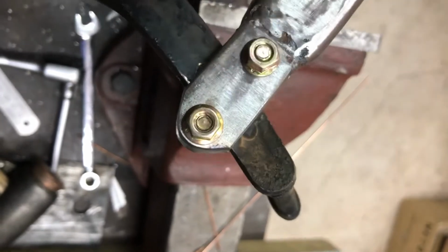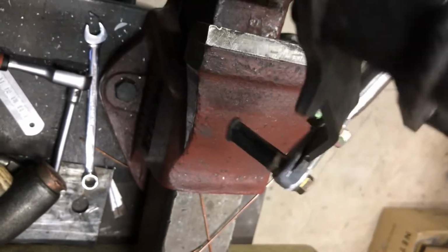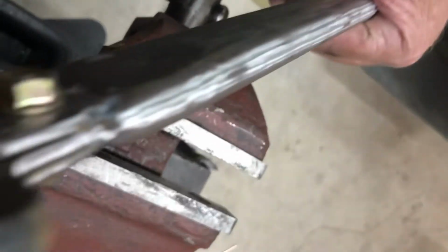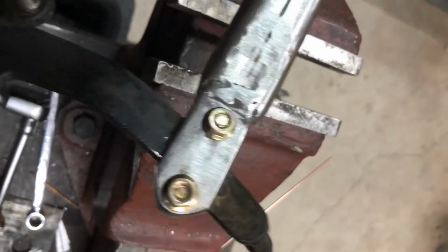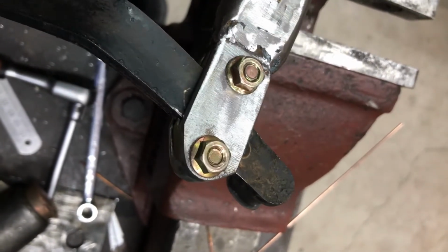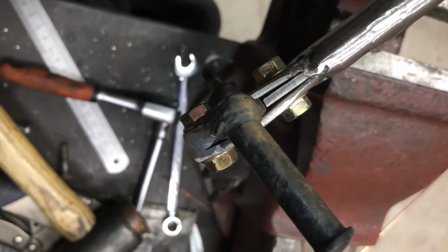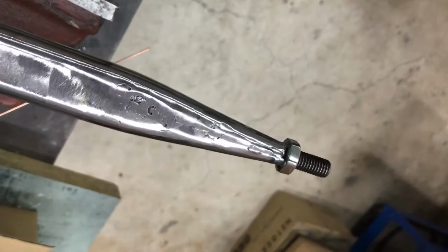The little washer I fitted in there behind the cut spacer, I must have cut down to the same radius as that washer. So that clamps, and the spacer in the centre there can come out to enable the pedal to be taken off. But you can see one bolt there has more threads on one side than the other because it's clamping a thicker material on the pedal. Anyway, that's that end done. I'm happy with the fish mouth and the thread in that end. So the next step is to make a knob.